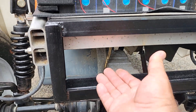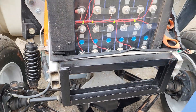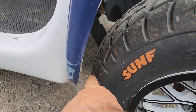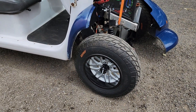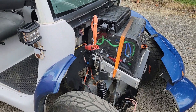Here's the cradle — it was up under here, and it moved two inches forward. The two inches forward allow for these 26-inch wheels to not rub when I turn. Before doing that, even 23-inch wheels would rub. Everything else is stock.